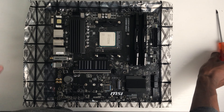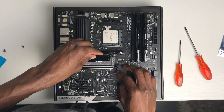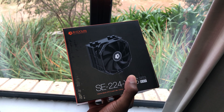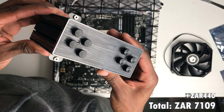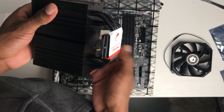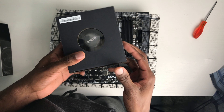After the RAM, I like to install my SSDs next. For my SSD I went for the Hikvision PCIe Gen 4 SSD, and I was pretty excited to test out the speeds launching Windows and launching games. Spoiler alert: if you have a Gen 3 SSD already, it's not significantly faster, but it's still pretty fast. I'm installing the SSD in the first PCIe slot because it's the only one with the heatsink and it has a direct lane to the CPU, allowing it to operate at its fastest. Remove the heatsink, insert the SSD, then put the heatsink right back on.